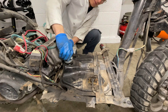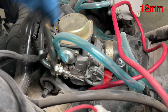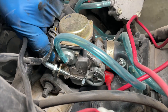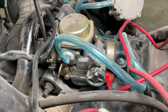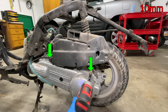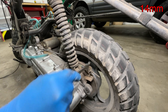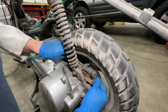I'm disconnecting the fuel hose from the tank and dumping the extra gas back in. Use a 12mm wrench to loosen the nut that holds the throttle cable. Pull it out of the bracket then disconnect the cable from the carburetor. I'll need to loosen the hose clamp that holds the air intake tube. Two more bolts hold the airbox above the transmission. The rear brake cable nut takes a 14mm wrench. With the nut all the way off, I can pull the brake cable out.